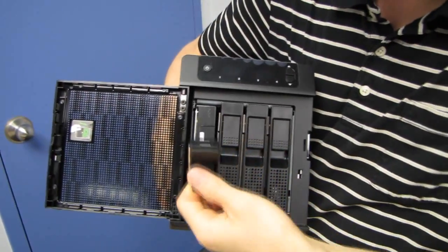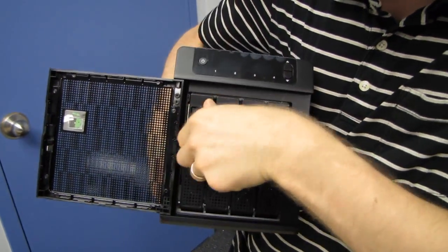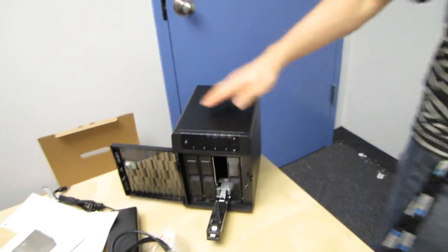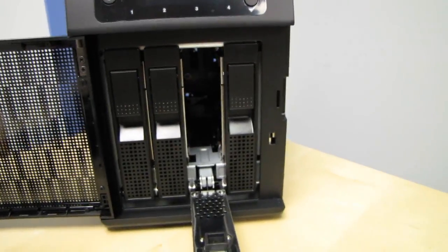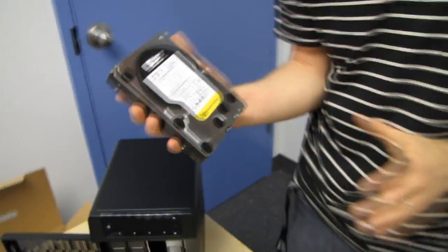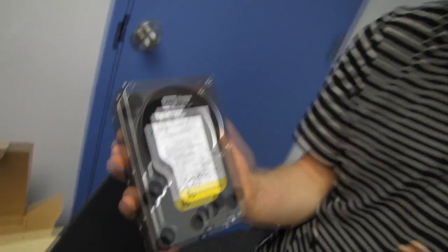In terms of drive mounting, it's actually very straightforward. Our Sentinel is a four terabyte unit, but WD sent us an additional drive. It should be noted that it's a special SKU that goes into the Sentinel — WD is taking the data security of small businesses very seriously. You can't just use any RE drive; there's a compatibility matrix available online showing which drives you can use. For the same reason it doesn't support RAID 0 or JBOD, it does not support non-enterprise grade hard drives. This is a business-class piece of hardware.